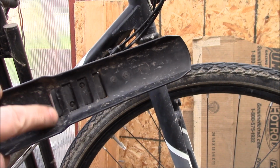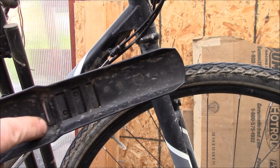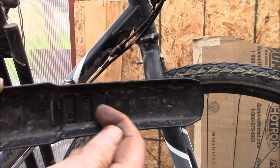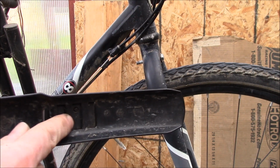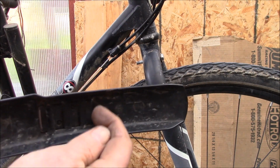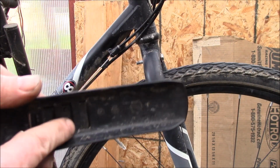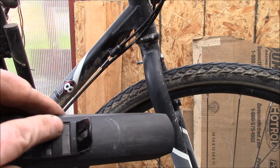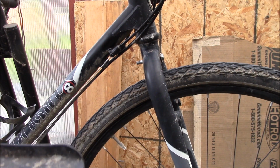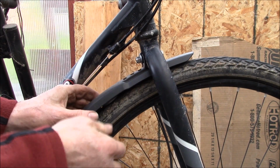Yes, this is that metal tab under there. The only thing I had to do to it was file off this sharp edge right here on the end of it, because as you go through these slots, the tab wanted to go underneath these pieces here. So if you put a little bevel on the bottom side, it'll go over, because you need it to go over the bottom slots, and then under the top ones is easy. And then I just took off the very bottom. Okay, there we go. Got the nut on there.